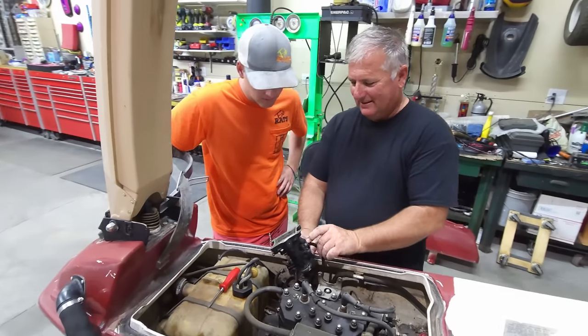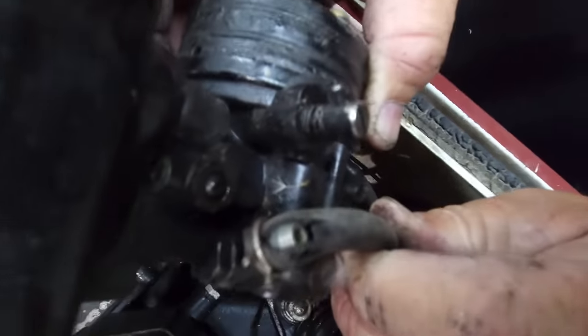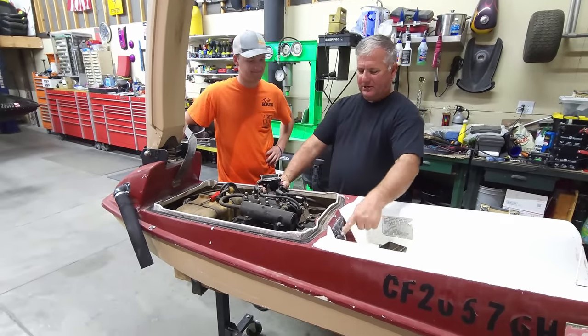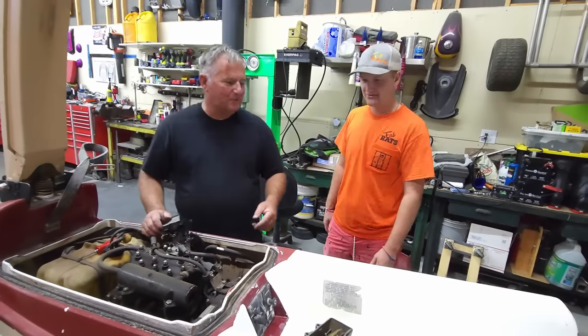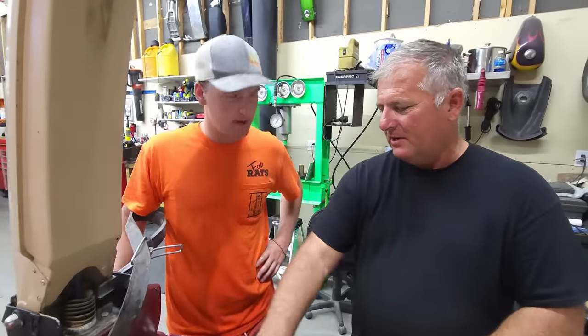See this here? That's not good. No, that's probably a bad sign. We're going to redo the fuel lines anyway because we don't use the on-off reserve. Did you turn your fuel? No, you saw it was frozen. That's ethanol fuels. Ethanol swells that stuff. It just eats it. So we'll bypass all that and go straight to here.